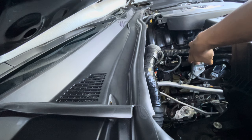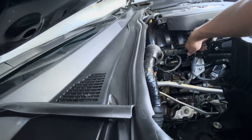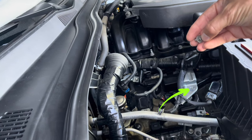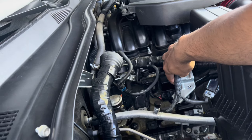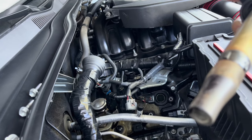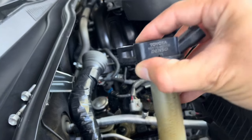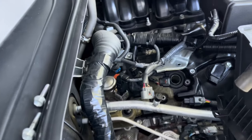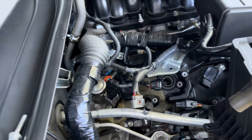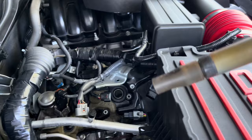This wire is connected to this metal plate, so I'm going to loosen it down and see if anything's holding it from the back. That screw is out — 10 millimeter bolt, pretty simple. I loosened it up and I can get to this after I disconnect a couple more wires. The ignition coil is now out and I'm going to clean this one up and save it as a spare. It was honestly pretty easy to get off with a total of three 10 millimeter bolts.